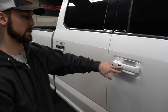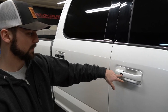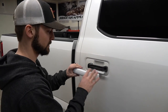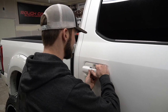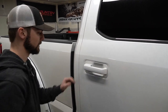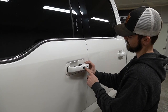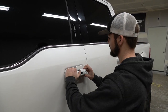This one is side-specific because it only has the intelligent entry sensor. The ones on the back are universal for the most part, but same setup — stick that in, push back while you push back on this side, and it pops on. This other handle is side-specific because it has both the intelligent entry sensor and the keyhole, so it can only go on the driver side door.